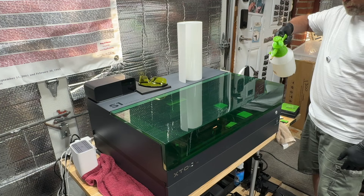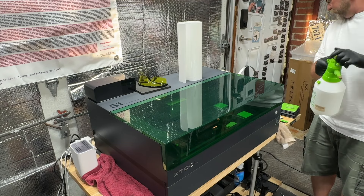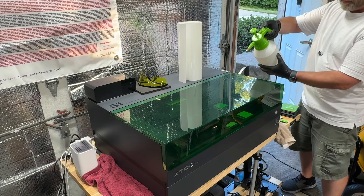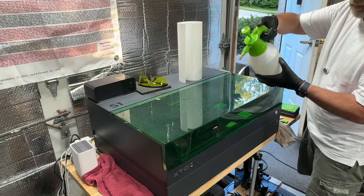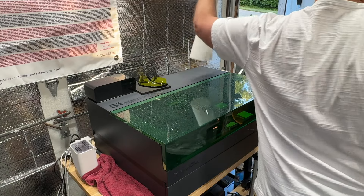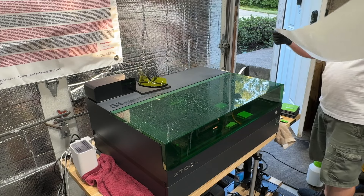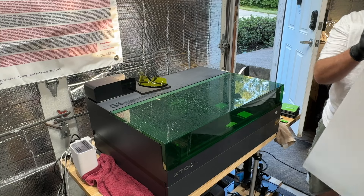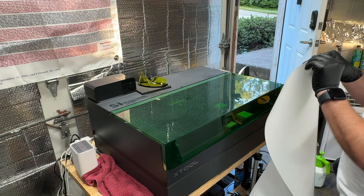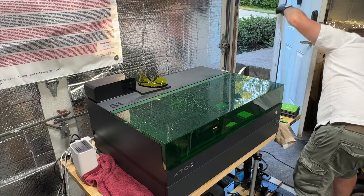From when I've done tint in the past, it's always best to make sure the film is really wet. I've never worked with this stuff before, but we'll see. So this is the soapy solution — that should be plenty. Now I'm going to peel this backing off, wet the whole piece, and lay it down. That's usually the best way. Getting it started is often the hardest part — there we go, I got it started.